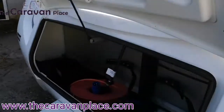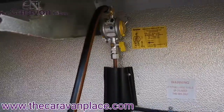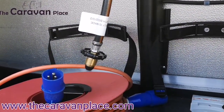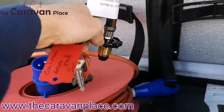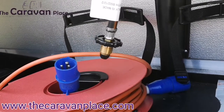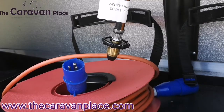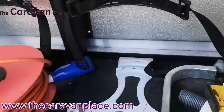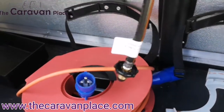At the front we've got the gas connection and you don't need any regulator — it's all built into this one, so it's literally just a red propane gas bottle. It's on a hand wheel so you don't need any spanner, and it's reverse thread, so when you tighten it onto your red gas bottle you do it the opposite way to normal — just hand tight with a little nip. There's room for two gas bottles, just put the straps around and that will secure those in.